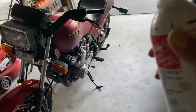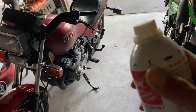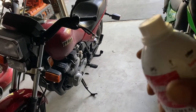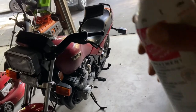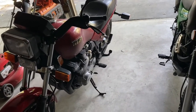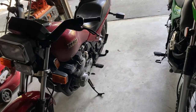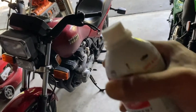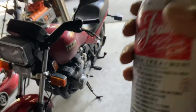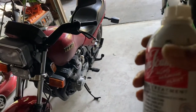Basically I let it sit for like a day. Then when I went to restart it, it was like boom — backfiring and white smoke everywhere, all crazy, and I had to choke it all out. My idle screw was in the wrong setting, but I think the key was to leave it sit for at least a day.